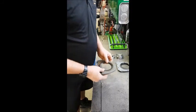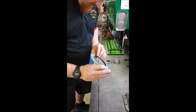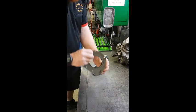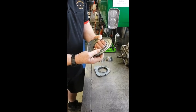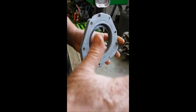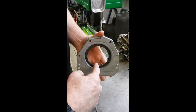Volkswagen have recognised that and come out with a new and improved version. The new seal is peened and bonded in there a bit better. The difference between this seal and the old one is that the old one pushed on straight over the back with the lip facing out — not the ideal design. They've overcome that with the new one, where the lip goes forward, so it acts as a bit of an edge for the oil to come up against instead of being able to flow through — it comes up against a sharp edge.